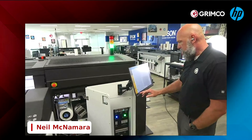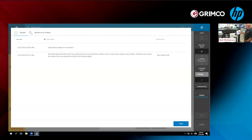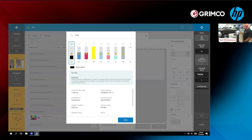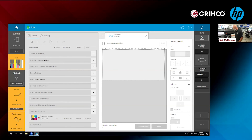It's popping up on my screen now — I've got dual touchscreens on either side of the printer. It's alerting me to expired pre-treat and a detected problem, so I'll do a reinitialize and it'll clear those errors. It's giving me full visibility: how much ink I have, and I can check the health of my printheads. That's one of the beauties of HP latex systems — user-replaceable printheads. If I ever have a printhead issue after a long idle period, it's a quick, easy matter of pulling the old one out and dropping a new one in. The machine calibrates and I'm back printing. If you had your stopwatch started, go ahead and cancel it — we are ready to begin the print process.